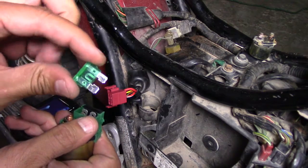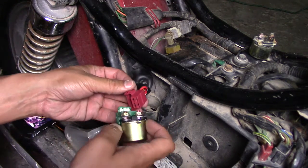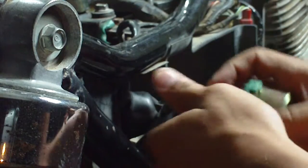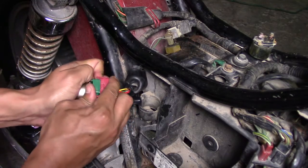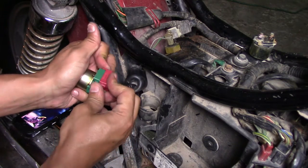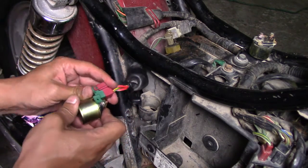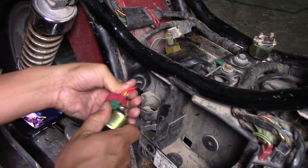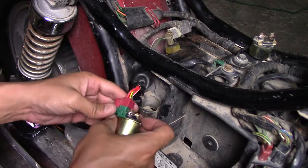And there we go — we've got a brand new plug for our starter solenoid. From here I'll just be able to take my new starter solenoid; as you can see it has a fuse on it, fuse is good, it's brand new. All I have to do is clip it right in here. There we go, just needs a little wiggling — it's a very tight fit but it's good. Our wires are holding, so from here I'll just hook it back up.